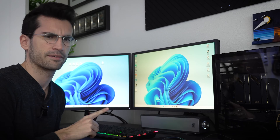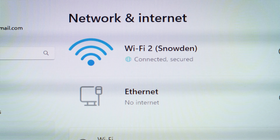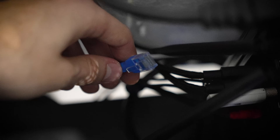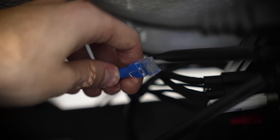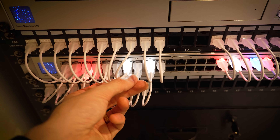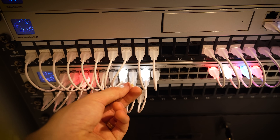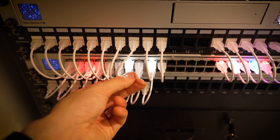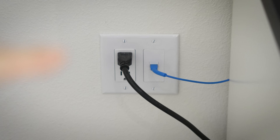You can see occasionally an ethernet tab pops up, but then it disappears just as quickly, almost like nothing is actually connected. I swapped out this cable, thinking it's the potential culprit with a known working one, yet the symptom still persists. On the server side, we're not seeing any connection at all — even though I've got the ethernet cable wired directly into her PC from the wall, my switch is showing that nothing is actually connected. I have installed LAN drivers and tried reinstalling different versions of the same LAN driver, to no avail. That leaves us with this guy.